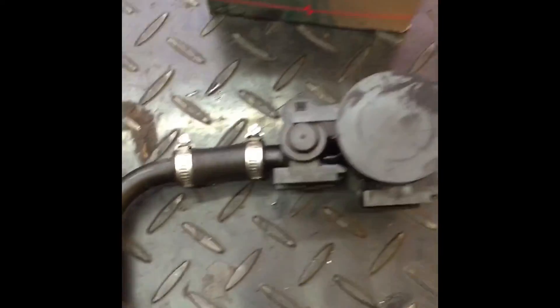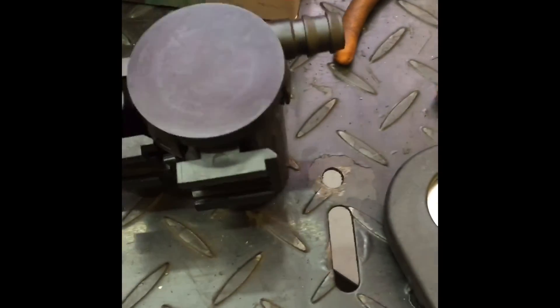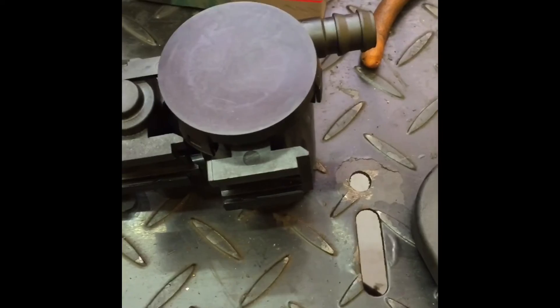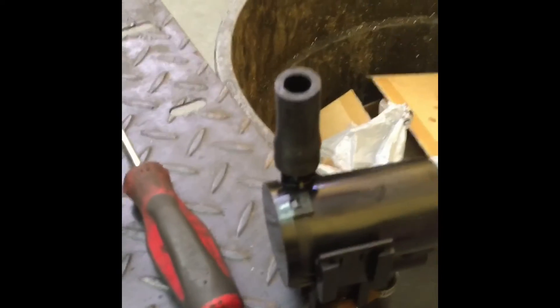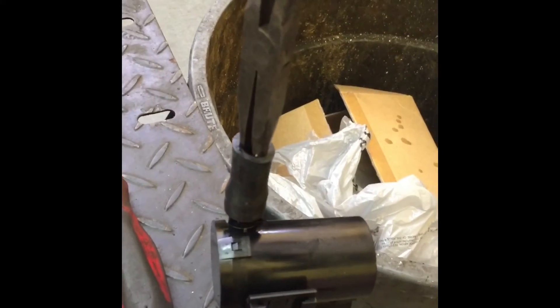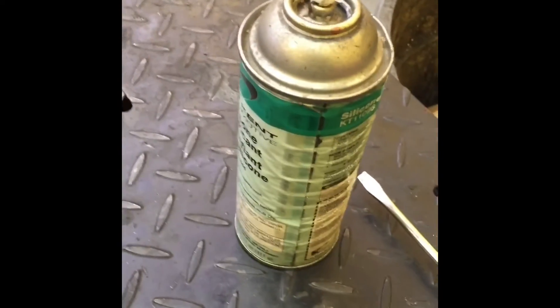So that's what it's going to look like when you're done — we're hooked up. It's a pretty tight fit to get that half-inch hose around those parts, but that's how GM says to do it; this is all straight out of GM's service manual. Now we're going to repeat to connect this top port to that other janky little accordion hose, and it does not have to be an airtight seal, so as long as we can get it to slide on there we're golden. One thing I do to make that hose fit a little better is get some needle-nose pliers and stick them in there and just pull it open as hard as I can — it'll give it just a little bit of stretch. I'll also put some spray lube in there, but soapy water will work just as good.